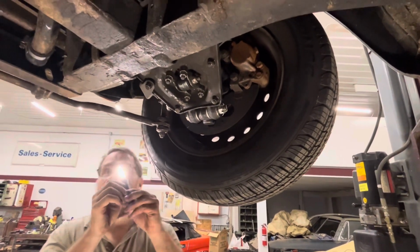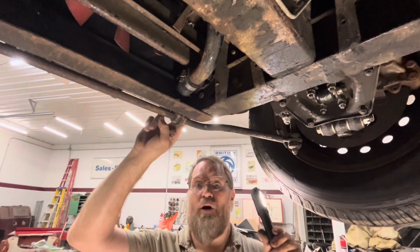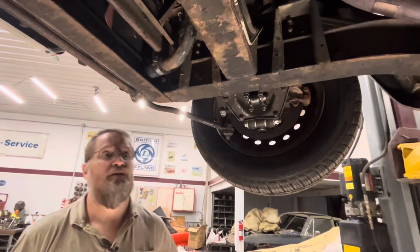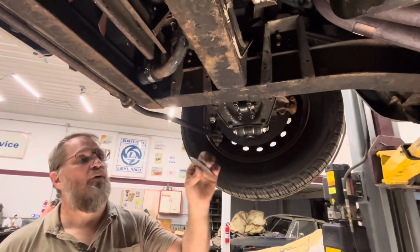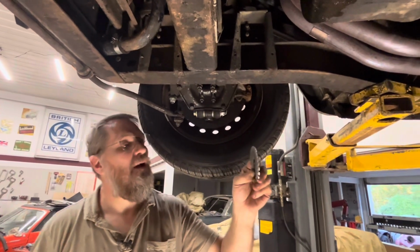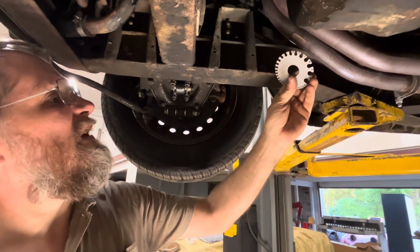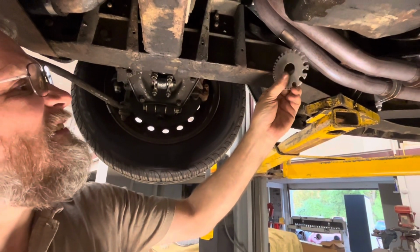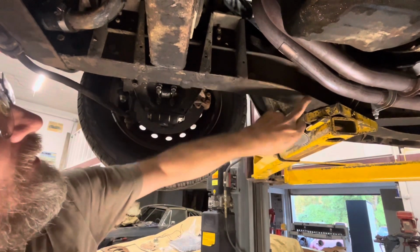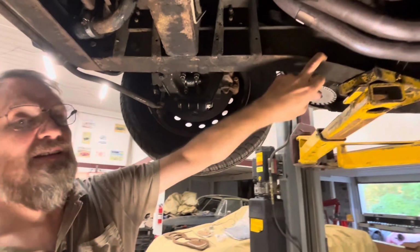Now these chassis, like I said before, are not super strong chassis. I've got my sheet metal gauge here. I've always heard that these were really thin. I've known they're thin, but I've never tested one before. And after putting it on here, it actually checks to be about a 16 gauge each. Well, that's not a good spot because there's not an overlap there, but it's about 16 gauge. So yes, these are not that strong.